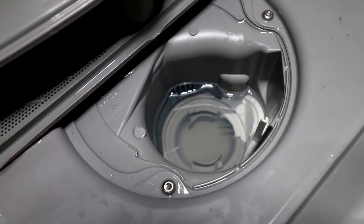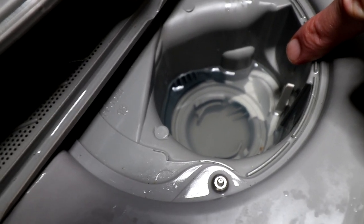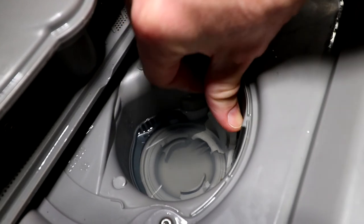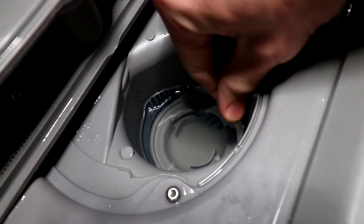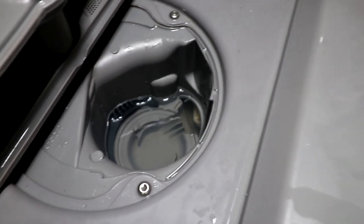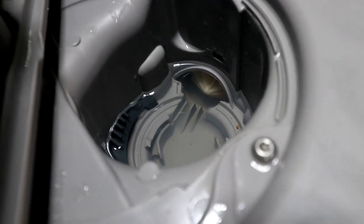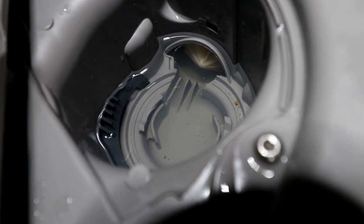Normally some food can get stuck in there, and if it does make its way to the impeller, you can prise this little white piece open. So you just grab your thumb behind there or use a spoon — I've literally just pushed it forward like that and it kind of unclips. Lift it out a little bit and then up. This is exposing the impeller, so you might get a few bits stuck in there as well. Let's have a quick look — there you go, a good look at the actual blades of the impeller. You can check if it's in good condition.